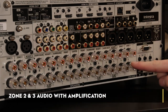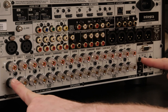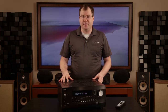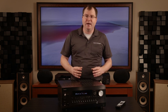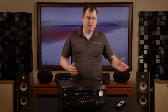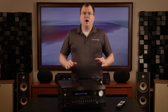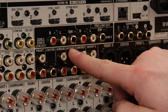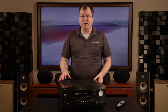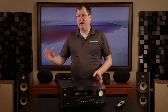Another amazing feature of the DRX 8.4 is the amplified and preamp zone 2 and zone 3 outputs. What is cool about the amplified side of zone 2 and 3 is that you don't have to sacrifice any of your main zone amp outputs to drive zone 2 or 3. On many entry-level and mid-tier AV receivers, the surround or Atmos height channels are often assignable and can double as either zone 2 or zone 3 outputs, limiting the total number of channels available in the main zone. That's not the case with the DRX 8.4 — all 11 channels in the main zone and the zone 2 and zone 3 amp channels can be driven all at the same time. Zone 2 and 3 preamp outputs also include a single subwoofer RCA output for each zone, allowing you to add bass management to your extra rooms driven by this AVR.